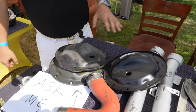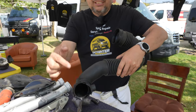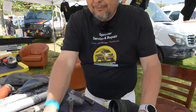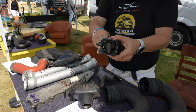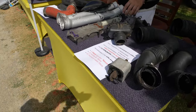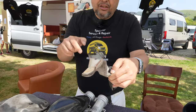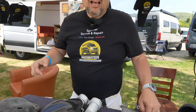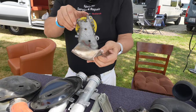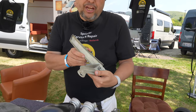When you do oil service, do not turn this without releasing the clamp — you can destroy this part. This is the bracket for the transmission. You have to replace it from time to time — this bracket gets cracked very often. Inspect it, and if you have a crack, replace it. This is the DPF bracket — also the DPF bracket on the four-cylinder engine. Bring it to us — we have a free inspection. Absolutely free.